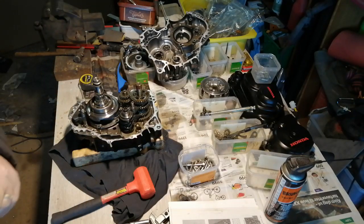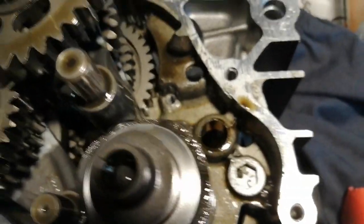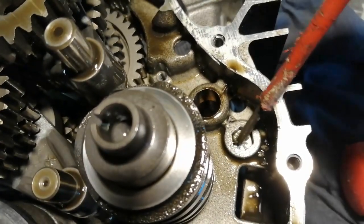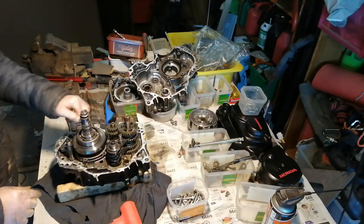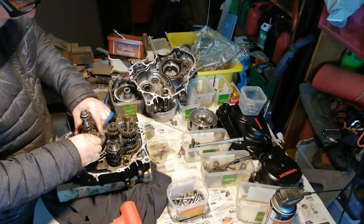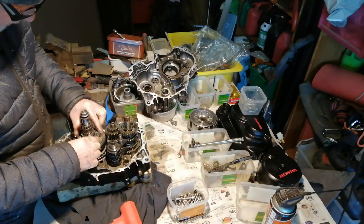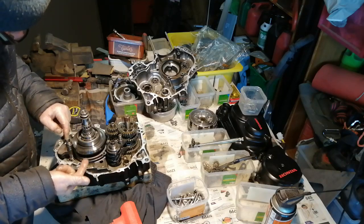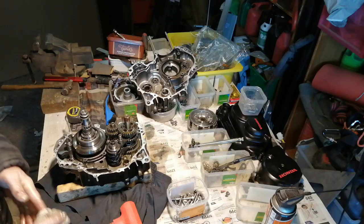Here's the rest of the engine - let's go have a look. In here, can you see? There and there - that's bits of piston. This bearing should have what they call no discernible play, which basically means when you move it rocking and backwards and forwards there's no play, and it should be smooth. And that is good. This one is good too, which means I'm hoping the other one is as well. So providing the little end is good and I can flush out the big end, this engine is going to live - very like a doctor pulling shrapnel out of a wound.